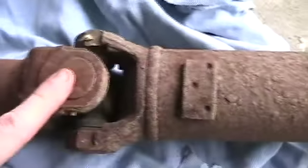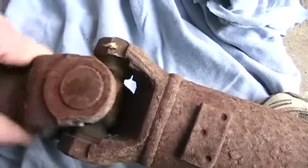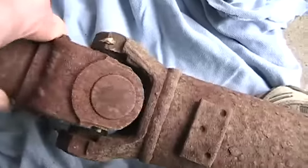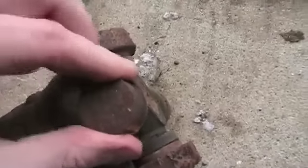This is our first u-joint — if I pick it up here and put it on my foot, it's nice and smooth, there's no play, no rocking. It's exactly right on the money. We'll come down to this one here — it's frozen, it won't move at all. It's bound this way and I got a little bit of play here, but this thing should be a happy camper, it should want to spin freely. Usually it's the rear one because all that salt and road dirt just beats on this poor thing. So we've got to take it out.